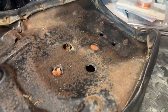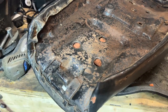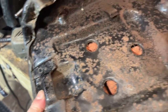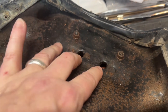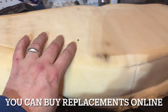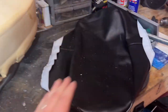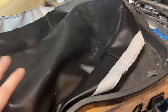We're going to have to dismantle this whole thing, de-rust, and repaint the seat. Note: this is a rear hinge seat — here's the front latch, and in the back is where we would mount the rear hinge. Once we tear the seat apart, I do have a seat foam in really, really good condition off of a later model CB350, and I did go ahead and procure a new seat cover for this.